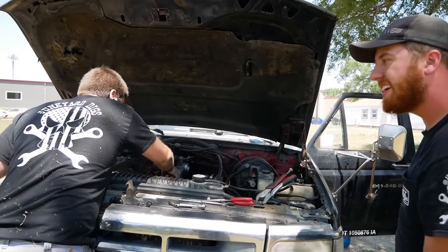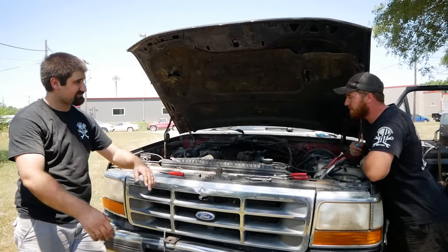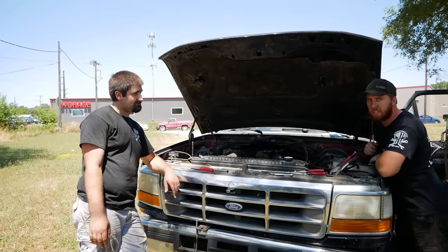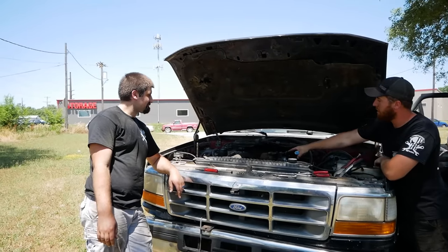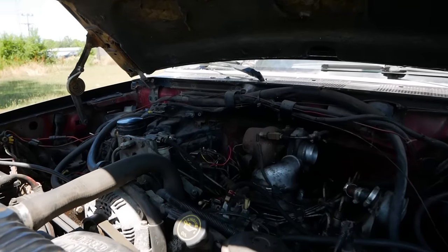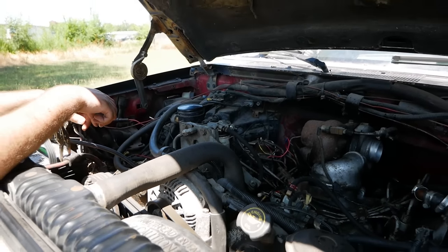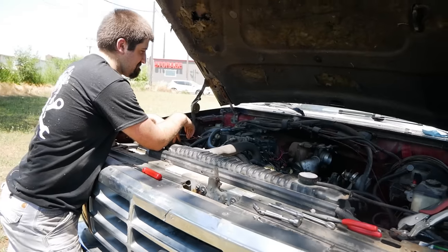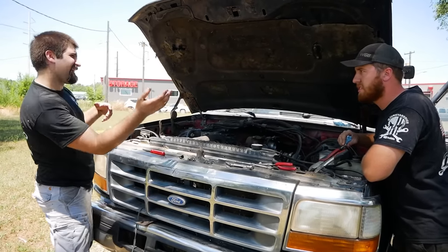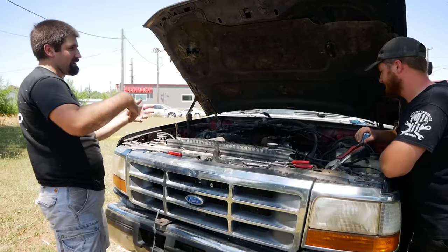Son of a bitch. I think the biggest differences we made were getting that oil in the cylinder, getting that compression back up, and we changed our fuel system entirely. I think we were airlocking that feed line like hell last time. So I have no doubt, going from the video I watched before I came up, I agree, you were dealing with an airlock. Just watching the exhaust, you were seeing a grayish puff, a white puff, a gray puff, a white puff. Yep.